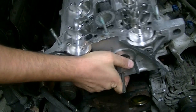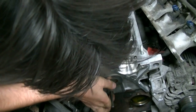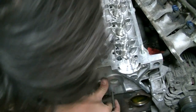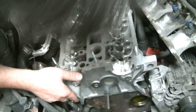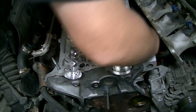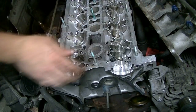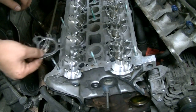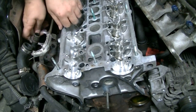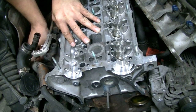Next we're ready to put the cylinder head on. It's going to take some wiggling to get it seated. Once it's on, double-check and make sure we didn't move the head gasket. Looks like we didn't — it should be all set. I should have put this earlier, but we can still pull on the exhaust manifold and fit that gasket for the exhaust manifold and hopefully line it up.